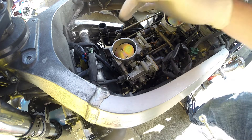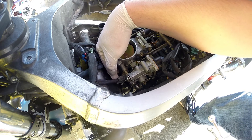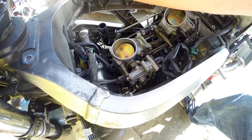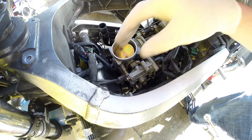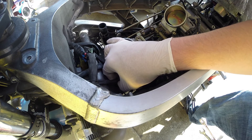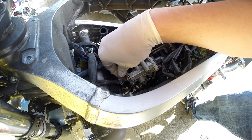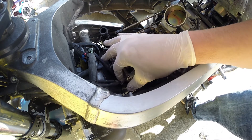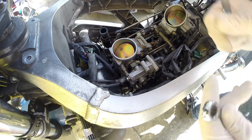The adjustment procedure starts on the lower adjuster, which is the return adjuster. You want to get 2 to 4mm of play in the throttle. I'm going to move the top cable out of the way just so I can get to it and lock it down — I think that's going to be the only way to do it.